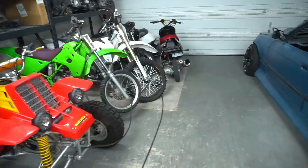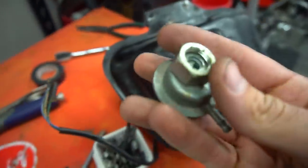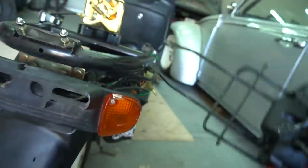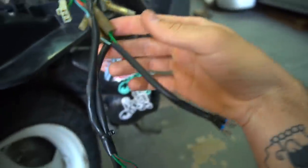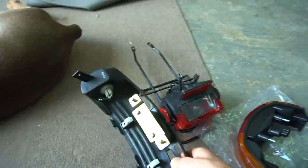She's in there. I just pretty much have to put the exhaust on. Going to run the stock exhaust now because I want to feel the bike completely stock, and then eventually we'll put on that S23 pipe I have when I probably go 70cc or when we mess around tuning this bike up. I had to get a new petcock — here's the one that just came out of the tank; it literally didn't even have a filter on it. Got a new one. Going to go ahead and do the JDM tail swap now. I just took off the rear tail light and I'm going to cut it right here back at the clip and go ahead and put the JDM tail in. You have to use different connectors for the JDM tail. I went through and changed all the connectors. Leaving this one at the clip so you can still unplug it — same with these. Now they're at the clip, so you can just unplug them from here and not have to go to the back of the tail light every time.